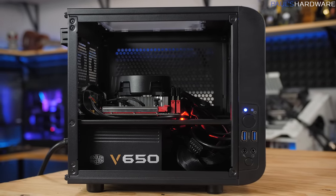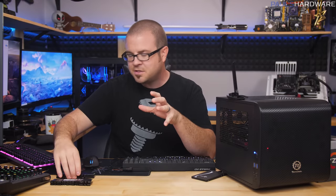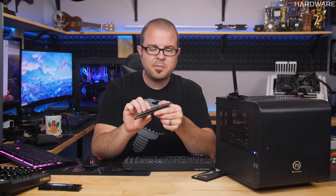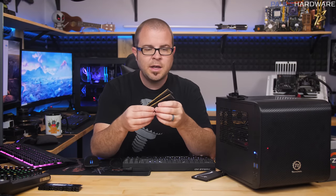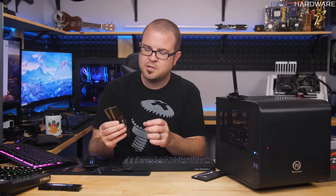Since I was okay on the BIOS update issue for this board, I set up the system according to my first five things to do with a new build video. I also installed an 8GB memory kit — I've swapped out the G.Skill Flare X kit for a G.Skill Ripjaws V kit, 4GB per DIMM, 8GB total in a 2x4 configuration, to test the recommended sub-$500 build. I manually set the memory speed to DDR4-3000 to match what you might get at home, so we can get about the same performance.